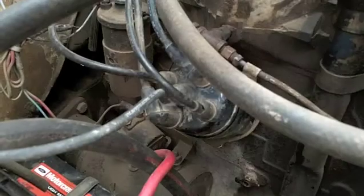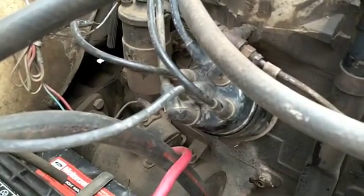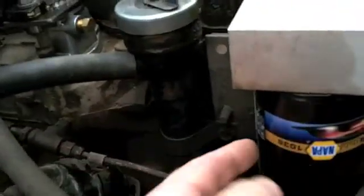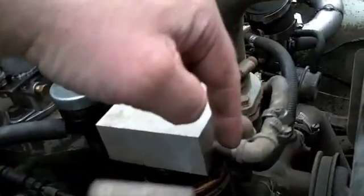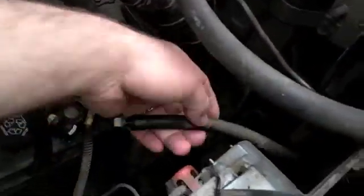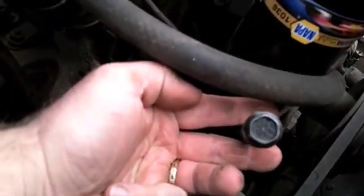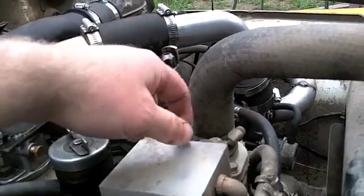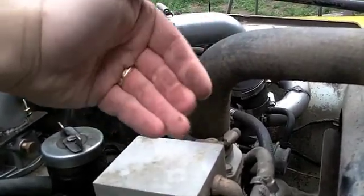It's running a mismatched set of junkyard spark plug wires that I keep promising to replace. The way I tap in for oil pressure for the turbocharger is to use this remote oil filter — something my father machined up for me. Rather than taking the outflow and running it down into the crank or the timing cover, where the standard oil outflow goes, I instead run the clean oil out to the turbocharger. It's not a tremendous amount of oil, but talking with the gentleman, I learned they don't really need a lot, and that is perfectly sufficient, especially when it's water-cooled the way it is. I don't have to worry about oiling the timing gears because I've got that little spray oiler thing that Jeeps are so famous for.